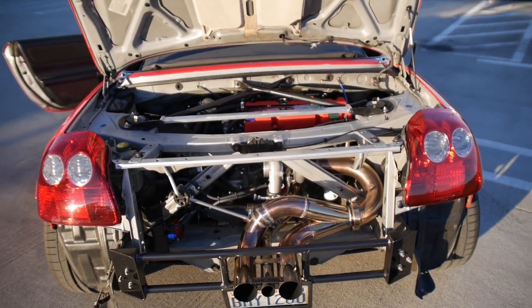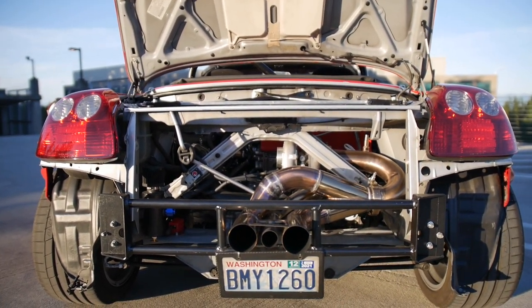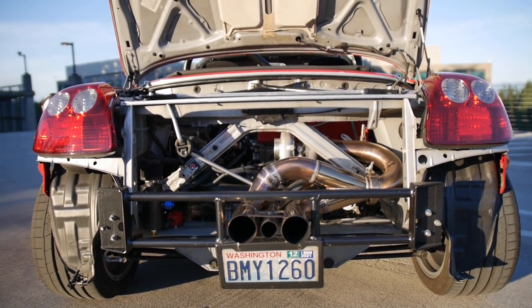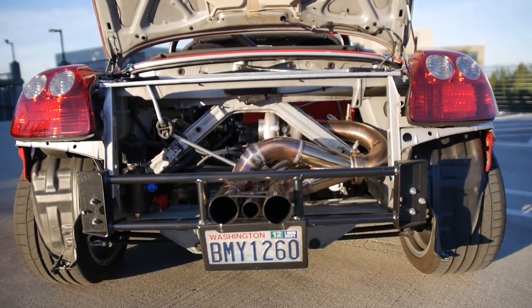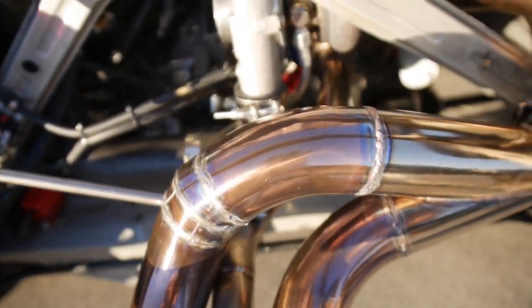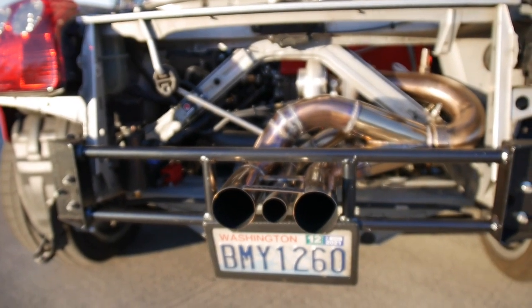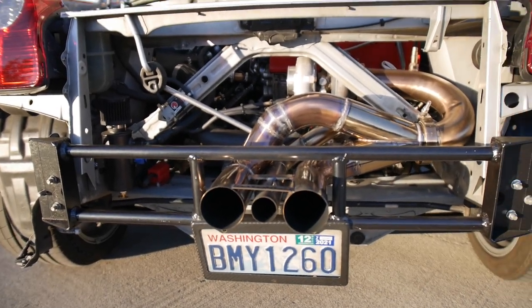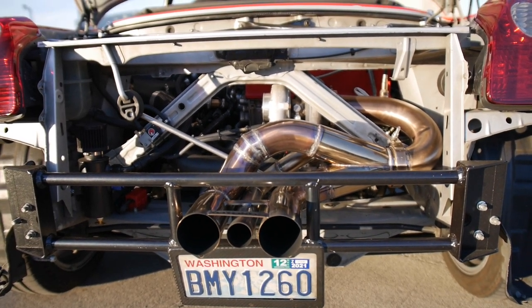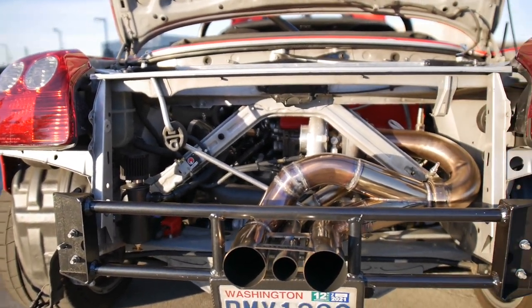We're going to go over first the inspiration. We've got the triple exhaust, just like the new FK8 Type-R — the turbocharged one with the reverse intake and all that. Basically the middle one is an open wastegate dump tube. If you look here, it routes to the back, and the wastegate is hanging at the bottom there going directly to the middle one, just like the Type-R. The left and right ones are just straight three-inch turbo back coming from the turbo. I do need a filter — he's going to make me a setup for that, or I'll just do one myself.